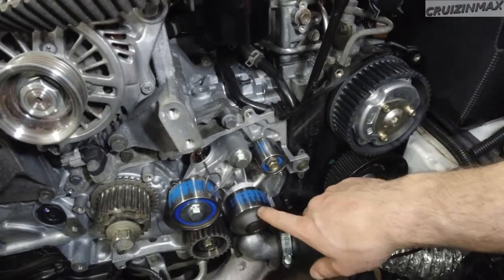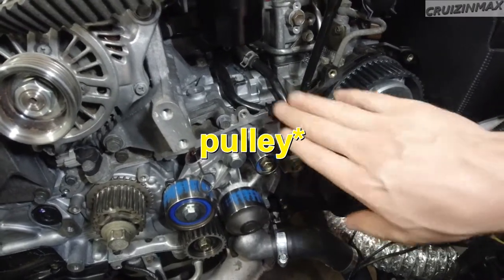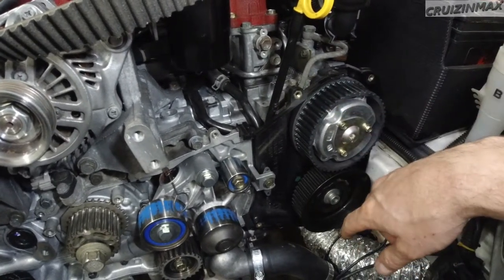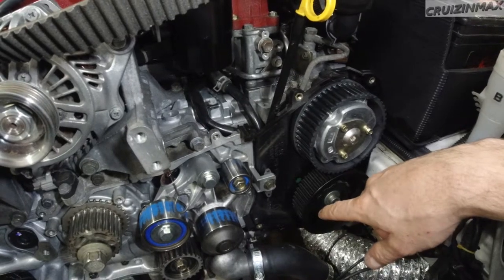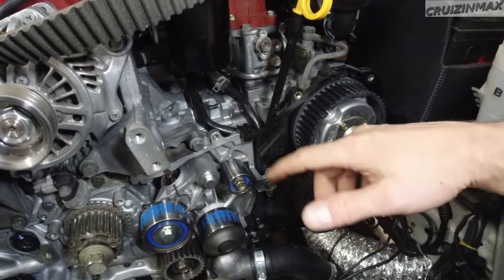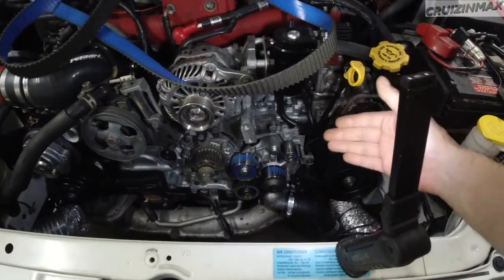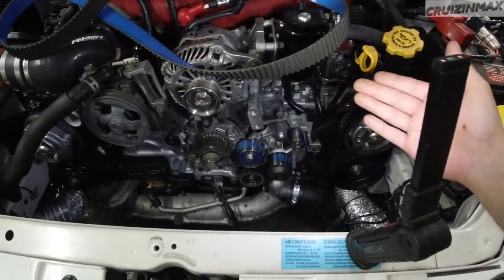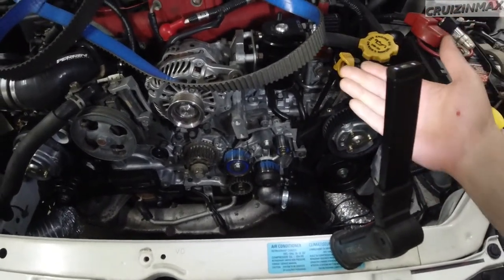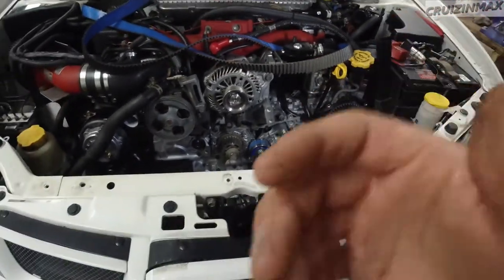I don't know about skipping time — maybe when it gets a lot of buildup on this belt, it starts to wander and may skip. If I had to guess, it would skip on this pulley over here. All I know is that this may cause issues later on. If I were to not check for 20,000 or 40,000 miles, I'm sure this would cause an issue. It may even cause the belt to break.